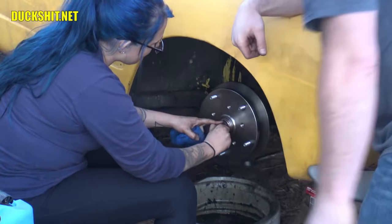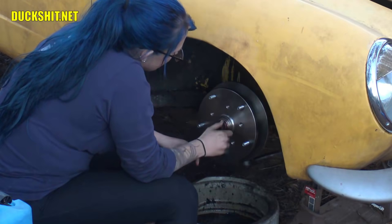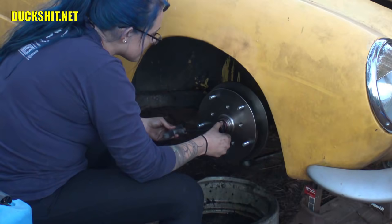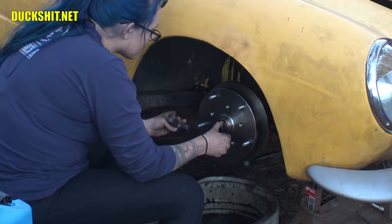There. That's it? You got 12? Yeah. Then tighten up your pinch nut. Observing where it's at. That's what sets, effectively, the end play of your entire rotor. So once that's on there, it should have very, very little when you wiggle it like this.